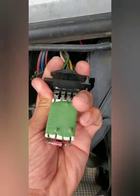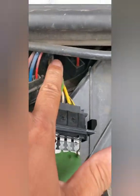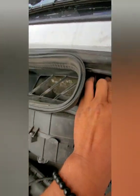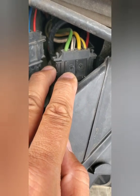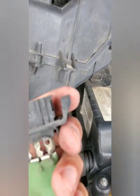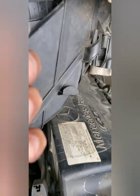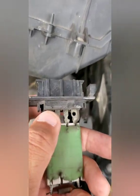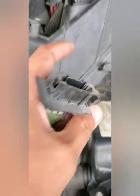I doubt I'll be able to do this with one hand though. I can connect that now. I'm just going to jam this up, set it in this hole, and snap it down — and I guess that's it. If you're going to remove it, you should squeeze that tab back there, then pull it back towards the passenger side, and that'll line up these tabs to the holes so it just lifts out — could have been a lot easier.